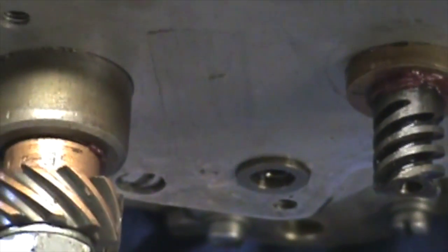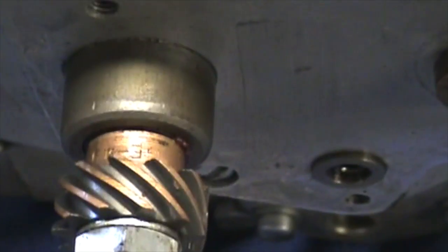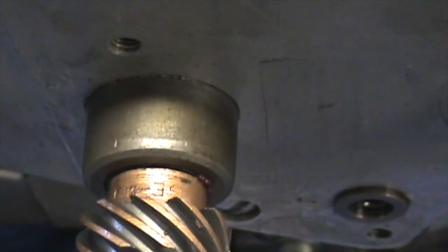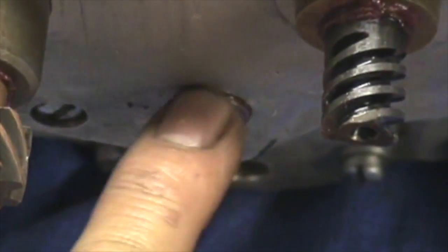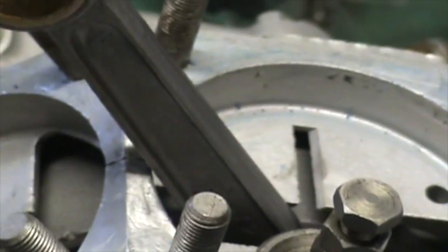At all times the motor should roll over pretty smooth. When you put your front sprocket on, it's going to bind it up a little bit because you're compressing that cork. Another thing: right here in back of this is a felt seal, and that felt seal needs to be soaked in oil overnight before you put it on. I feel that's pretty important.